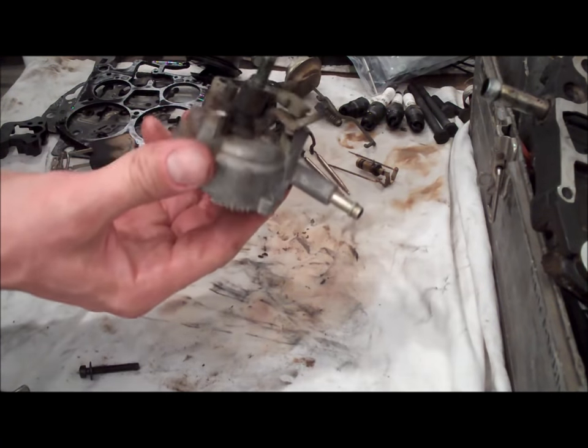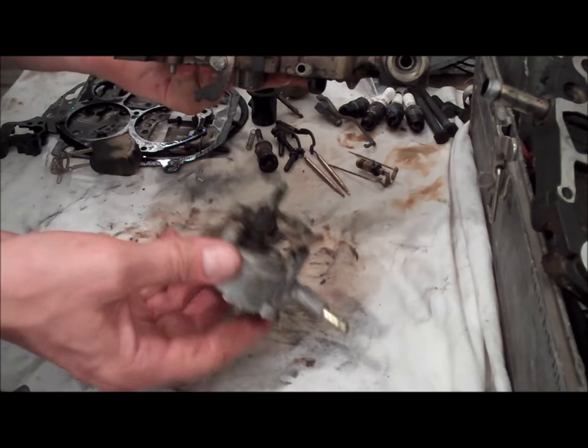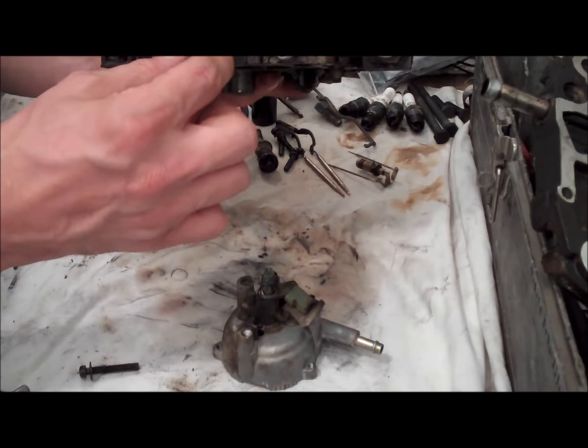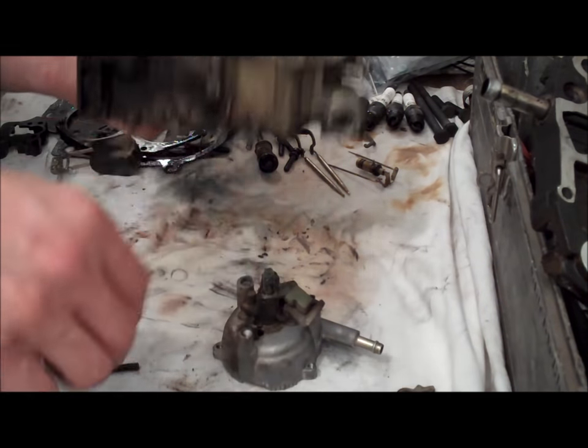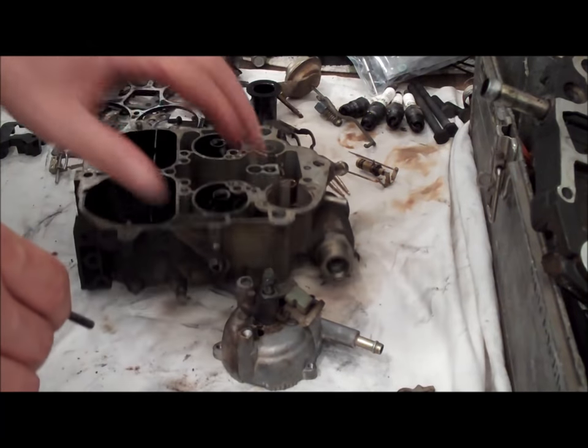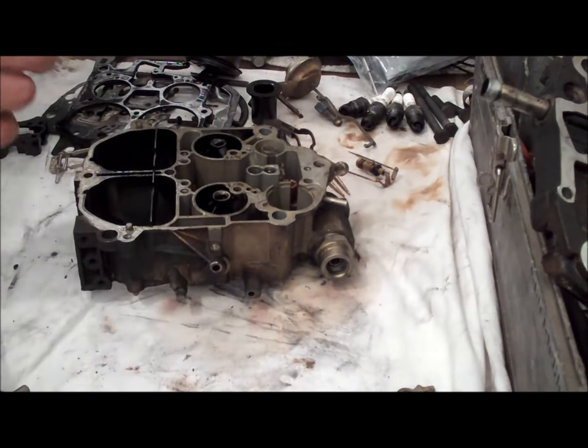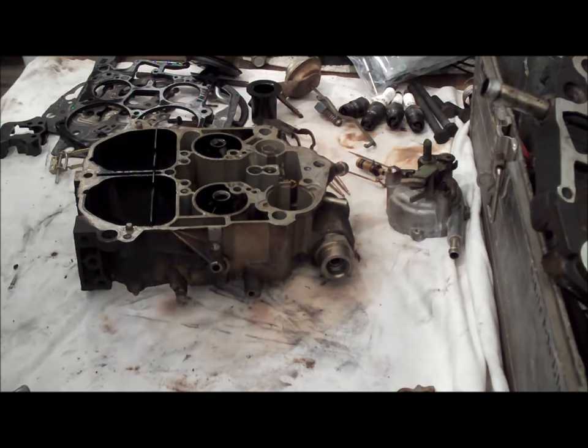You have this little arm right here. What this arm does is when the vehicle is cold, this arm is automatically engaged and prevents the secondaries from opening until the choke warms up. Once the car warms up the arm moves, and that will allow the secondaries to open — because you definitely don't want to be using the secondaries on a cold motor. Remove this screw and it all comes with it. Pay attention to how that arm went back on there and set that aside. That's full disassembly of a Quadrajet right there.